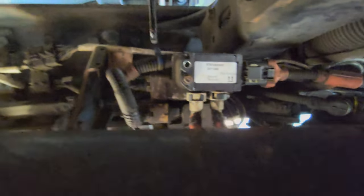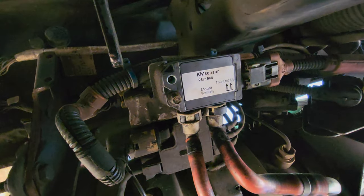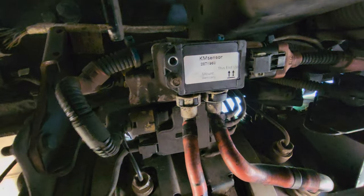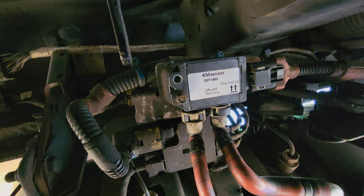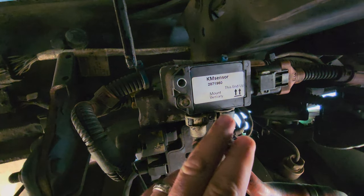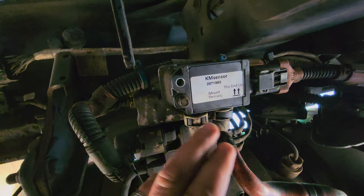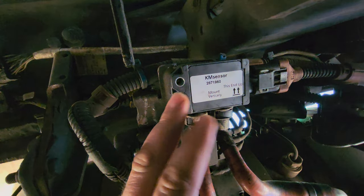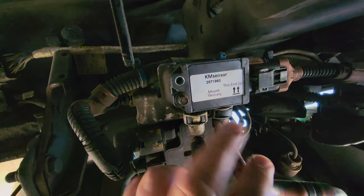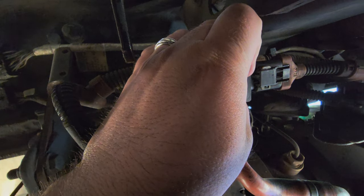The sensor has an inlet and outlet with two hoses coming out of the exhaust connected to it. To take them out, you have to remove those black clips from the top — where I'm putting my fingers. There are also two bolts you can take out. Take it out from the top first, then remove it completely. I did damage one of the bolts, so be careful.